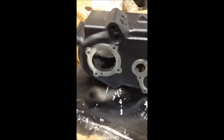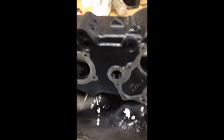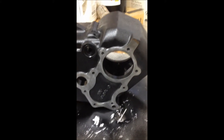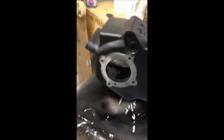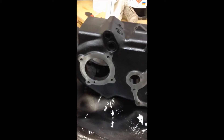The first step after you clean your case and paint it — this is the time you want to do that. Also, you want to pay particular attention that you clean all your gasket surfaces, sealing areas, and all the bolt holes of any debris or trash that may have come in during the teardown process.